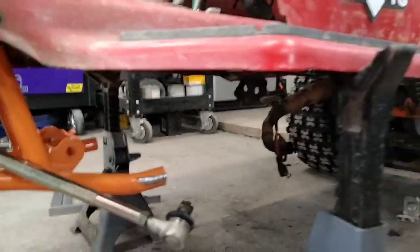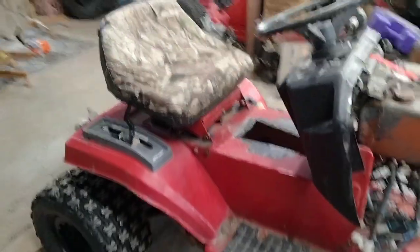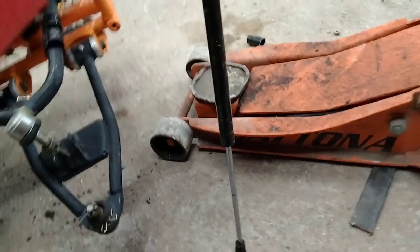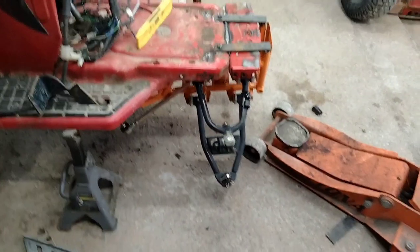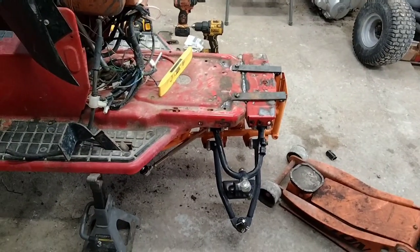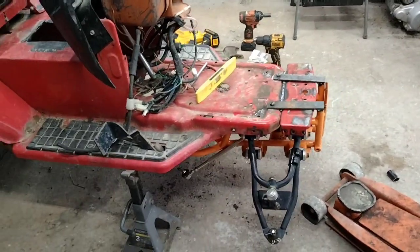We got these two pieces of flat strap welded to our orange tubes here, and then they're bolted into the top of the frame — that way it kind of hangs, and this is almost like cantilevered on there, so when you hit a jump it's going to want to force the back to go up. All we got to do is figure out some supports for the back of the frame. We obviously got to figure out steering still, but you can see it's the beginnings of a mower — or what used to be a mower, now it's going to have some suspension. We don't have the original shocks anymore, so we're going to be trying something new: a 15-inch tailgate or hood shock. I'm not sure the poundage, I think these are 75-pound rated, but they're pretty stiff and I think they'll work. Pretty much done with day one — next time we work on it, hopefully we'll get the spindles on there, see where our tire alignment's at, and figure out our shock geometry and go from there.